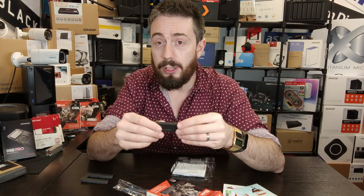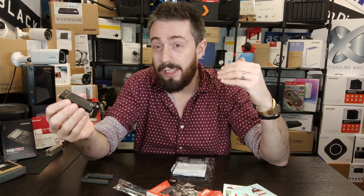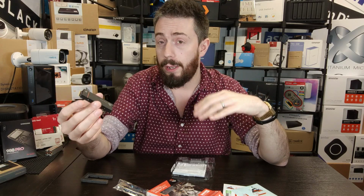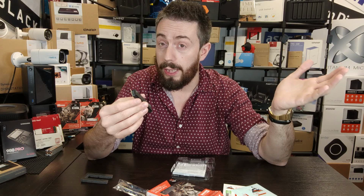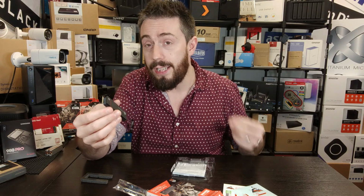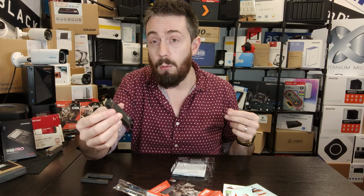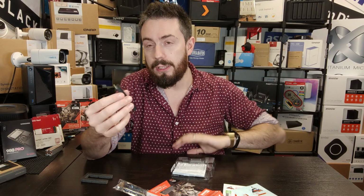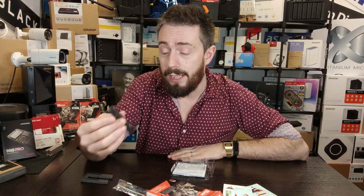The SSD, as mentioned, has got the Phison controller. It's got scaled DDR4 2666 megahertz memory being utilised inside, all the way up to the 4TB model that's got 4 gig there, and obviously it scales accordingly between them. We've already mentioned the NAND, and again, loving that stuff because the NAND overall on this makes it one of the most endurable drives in the market right now with a 0.7 drive writes per day.